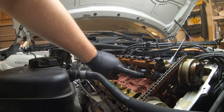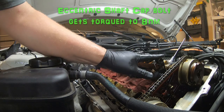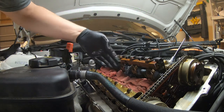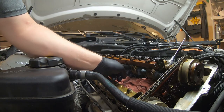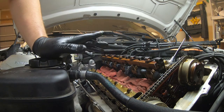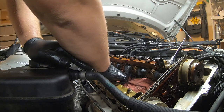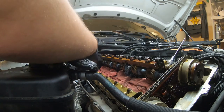I've got the eccentric shaft in there with the new shaft in, and all the caps are on. When you're going back in, because you're not taking the tension out of these springs, make sure you tighten these caps with about half turns, quarter turns on each bolt, and work your way back and forth along the shaft to make sure it goes in evenly. If you put too much stress on one end and not the other, there's potential it could break in half - I've seen camshafts break in half that way. Now that it's back together, put the eccentric shaft motor back in, put the new oil squirter on, and put the valve cover back on, and we're done.